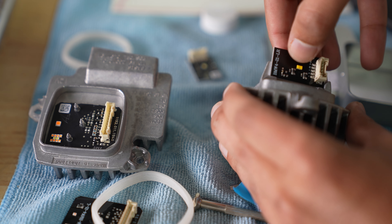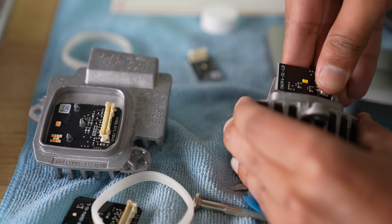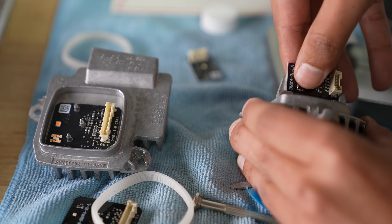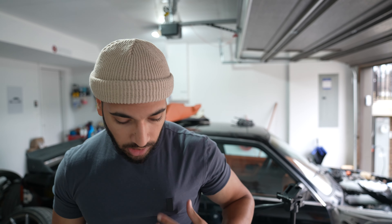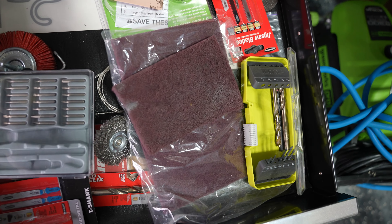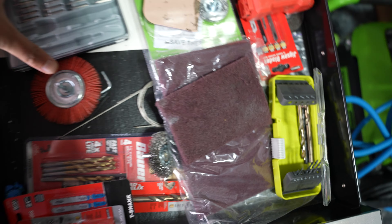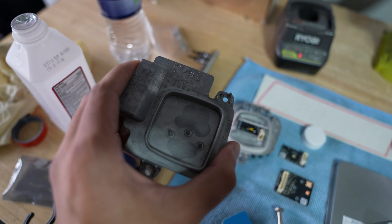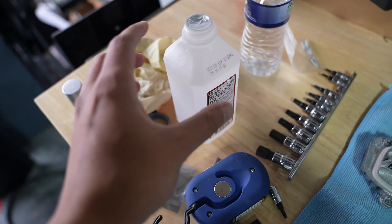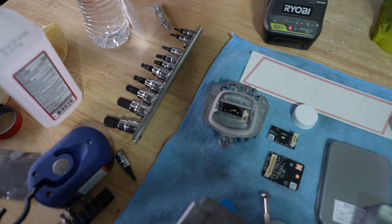I got the majority of that old glue off, so now it's just a matter of taking the new module, ripping off the backing paper, and sticking it onto the housing. It should sit in this orientation just like that. Just press it down from different angles. Now I'll do the exact same thing with the lower module — the one that goes inside the wheel well.